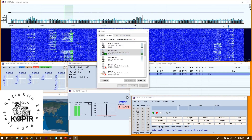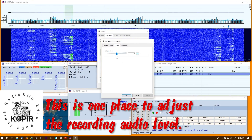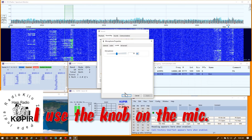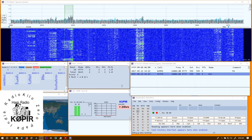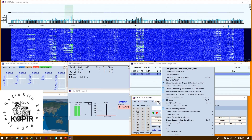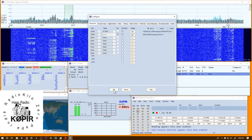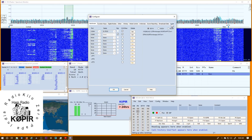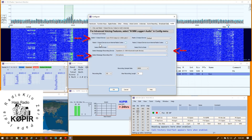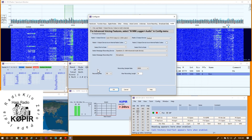I'm going to double-click on it, go over to Levels, and I've got mine set at 50. Now this microphone has a dial on it to change the volume, so I use that. I'll click OK. The next place I went was N1MM Logger — go to Config, then Configure Ports, Mode Control, Audio, Other, select that, then go down to the Audio tab and make sure it's set up right. This is what works for me — I've got an article on my website with some of these screen captures, so I'll put a link below.